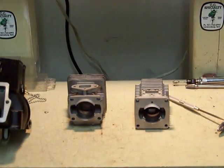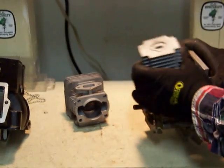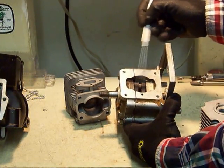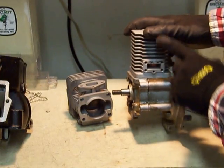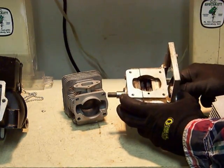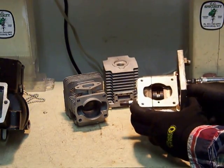Now, one thing about a two-stroke configuration — this is a little crankcase I've taken apart just for illustration. The two-stroke cylinder sits on just like this. See those two little leaflet valves right here? And these two little cut-out ramp-looking guides correspond to the transfers. They play a role in the intake as the piston ascends, allowing air-fuel mixture to be drawn in underneath the piston. There would be a piston connected to the crank as it rotates, and as it descends it forces air out into the transfer. No matter which section of ports we go over, you need to understand that — it's critical.